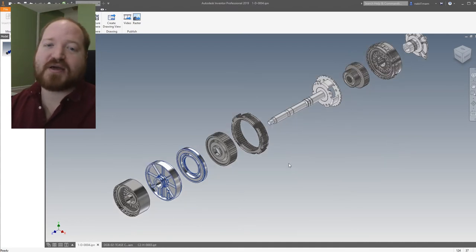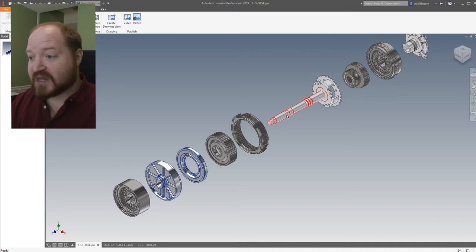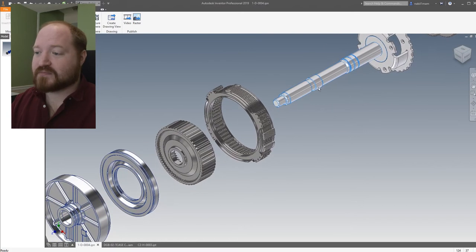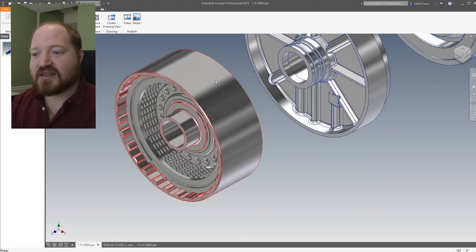The first thing I'm going to explain is how we go from two wheel drive to four wheel drive, and this explains why we can't have a full-time all-wheel drive Toyota pickup with this type of transfer case. The power comes in through all this stuff and then basically comes out this output shaft. On this output shaft one of these sections is splined, and this splined section is connected to this part right here, which is a clutch pack.